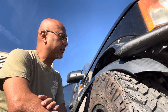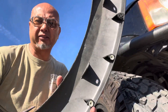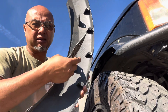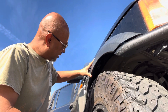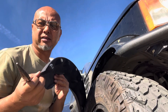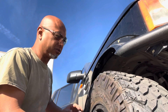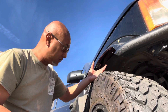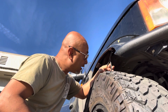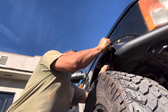I've taken off everything from the fender liner and the lower panel clips. There are a bunch of videos that show you how to remove these things — basically it would be great if you had one of those mini crowbar-looking panel tools that just pry up the center section and allow you to remove them fairly simply. You are going to have to remove the fender liner. You are going to have to remove your front headlight to get to the screw that holds the front unit, and you'll need to do that for the rear as well to remove the whole entire fender section. Once you remove the fender liner it exposes the back end of where these panel clips are located, and all you really have to do is just squeeze it.